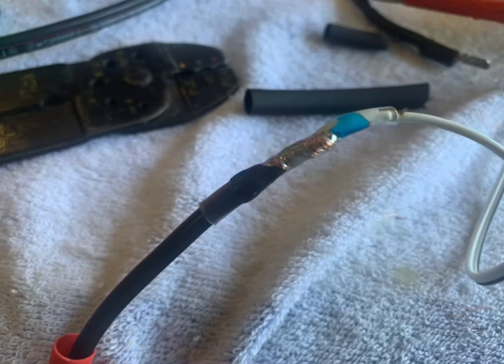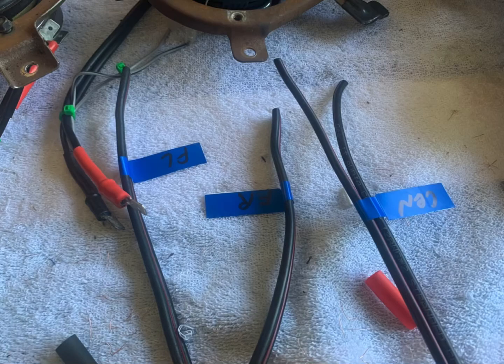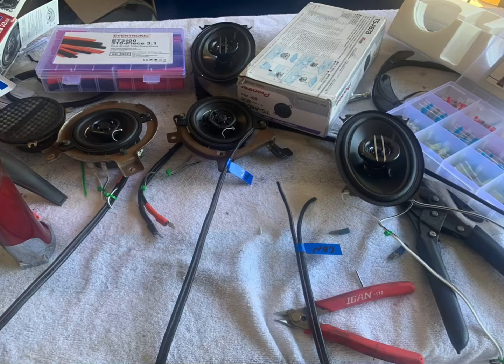And I think it's the best way to go. Just don't touch the copper with your hands. Use some latex gloves and what all, so your solder will stick to it. The oil off your hands will make it not want to stick sometimes. Then they're all wired up. I'm ready to go in the truck here, and double checking everything, make sure everything is okay with it.